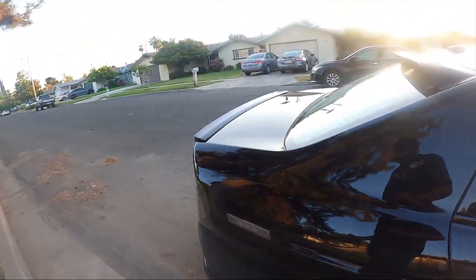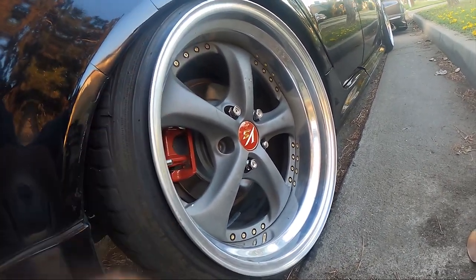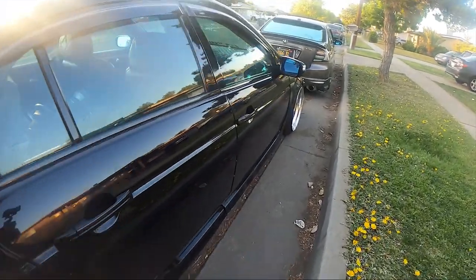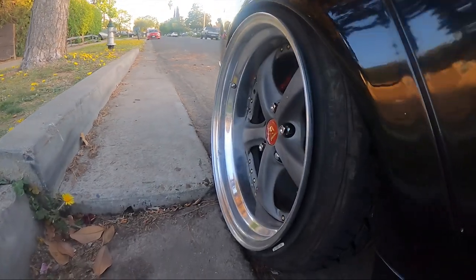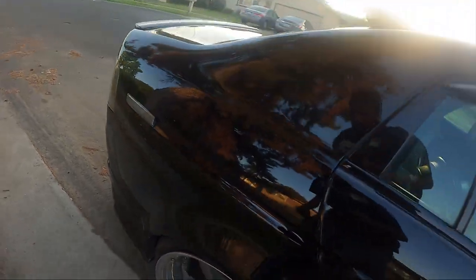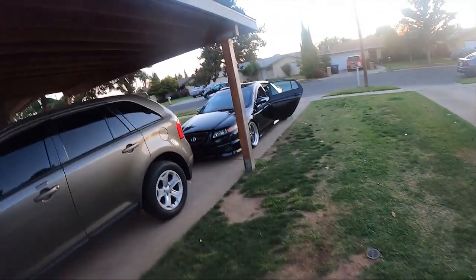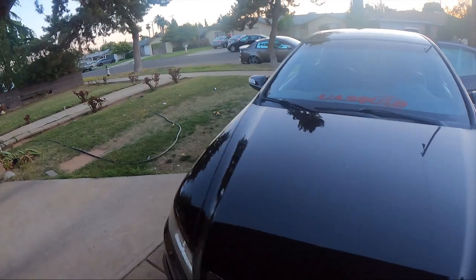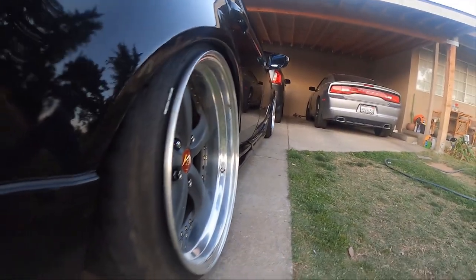These are Mariah's new wheels — VSKs from Green Chris, if you haven't noticed. 9.5s in the front, 10.5s in the rear. Not too sure on the offset yet — I'm gonna probably try to camber it in just a little bit, cause that's a little too close for our liking. So we're gonna try to camber the wheels just a tad bit so we don't rub too much.